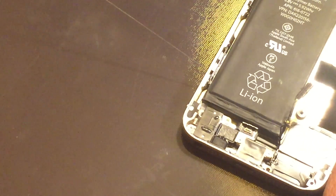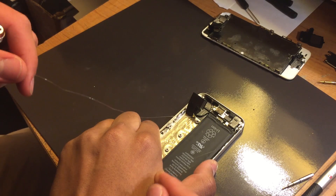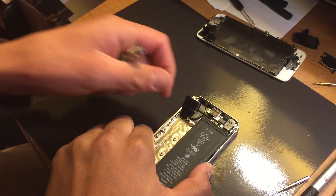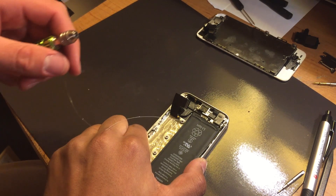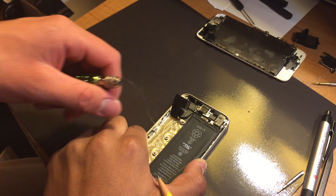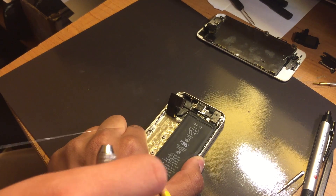Now it's time for the sawing motion. The two screwdrivers — what I've got to do is kind of pull them back and forth. I have an assistant here holding the battery down. These two have to be held as low to the phone as possible, not out at an angle. The glue is going to start going off under the fishing line. Sometimes the fishing line may begin to get caught under the glue — that's fine. If the line breaks, you simply go for it again. You can see the glue all over the line. That noise is just the line passing through the glue.